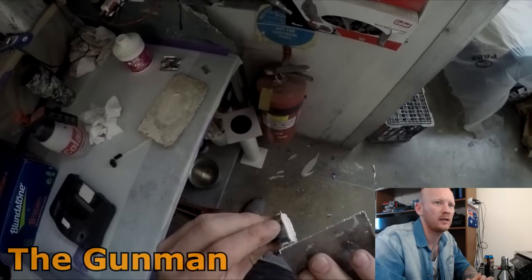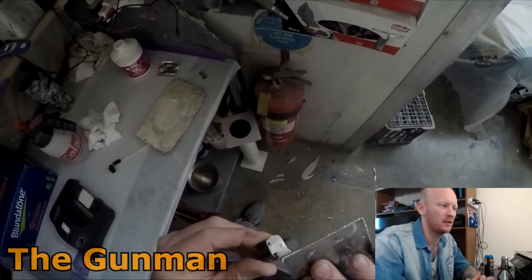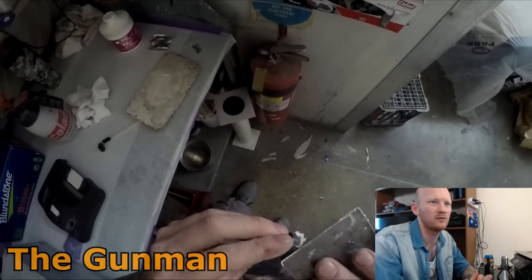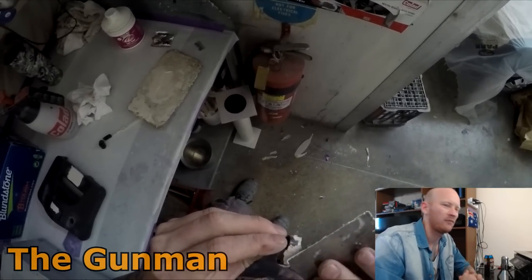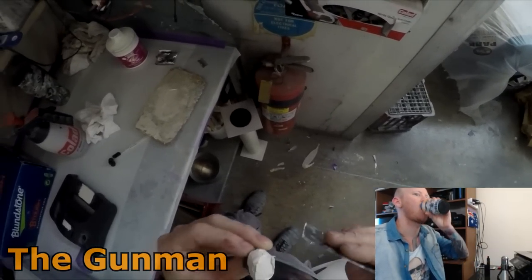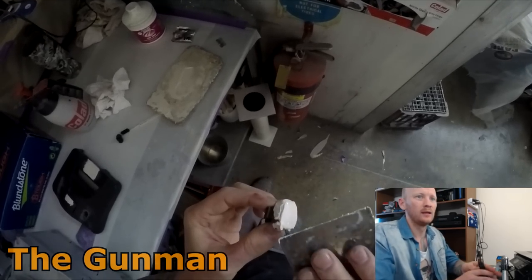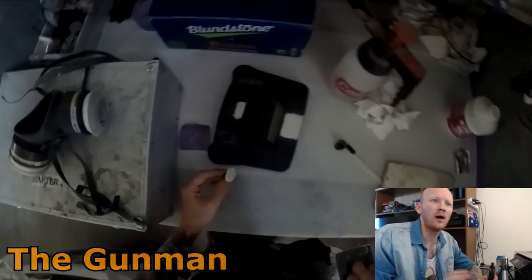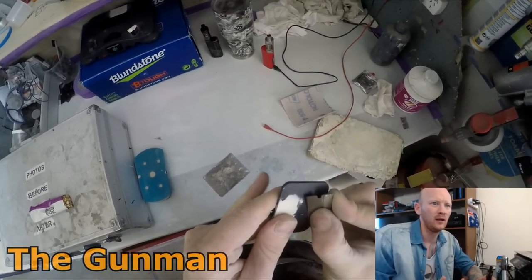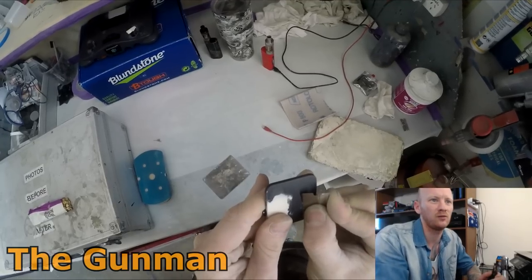So again, just going over that reset button, as you saw, it was pretty hammered at the start of this video. So I didn't really have a great deal of a choice but to fill that in and flush it out, but have no fear, it looks absolutely awesome. Just taking the time to get that filler in nice and neat, so that we don't get too many raised sections. If you don't get enough in, then you've got to be refilling, and if you get too much in, you're just going to have a hard time sanding it out.